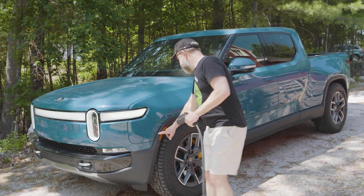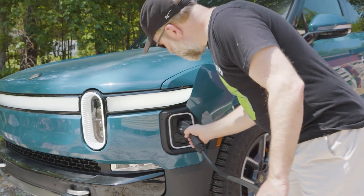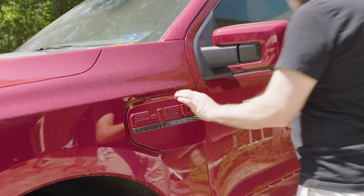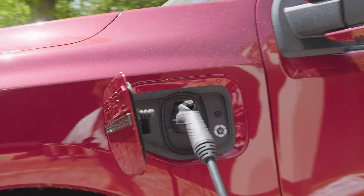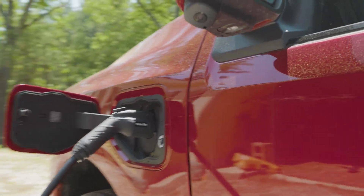It has a 25 and a half foot long charging cable, which is really long. I'm of the opinion that 20 feet is perfect — anything longer tends to be too long, but an extra five feet is nice if you pulled the car in the wrong way. Once you get over 20 feet, you just end up with tangles. The cable itself is relatively thick, which makes sense for 40 amps, but it likes to not be flexed — it's a sticky cable that doesn't flow past itself easily.